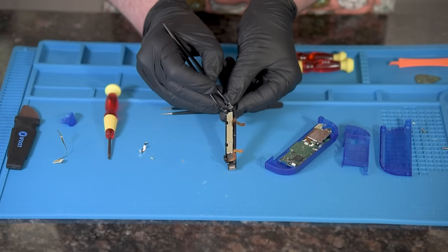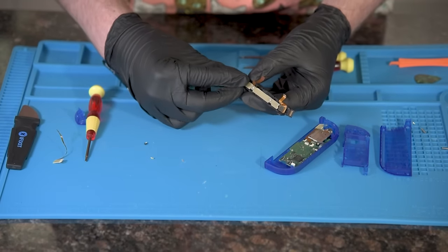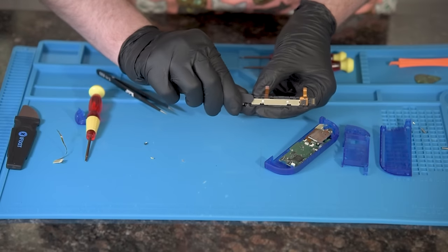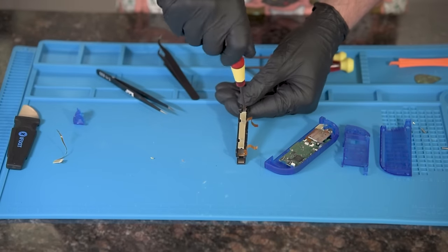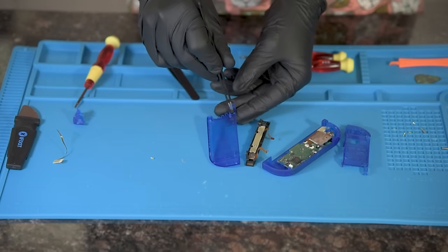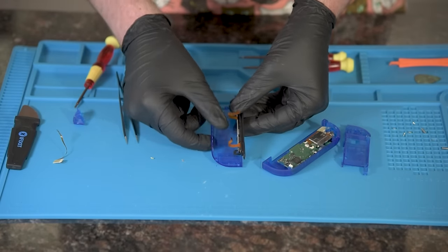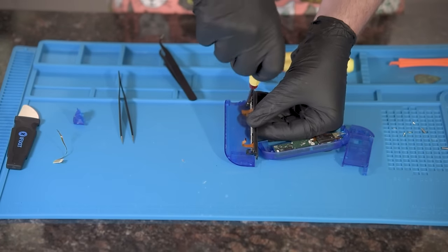Now we put the spring in the latch clip thing and slide it carefully, handle side facing upwards. Put the staple bracket over the latch and use the black screw to keep it in place. When that is finished, we will take the back shell and place the slide button in the hole. Use regular size screws to hold it in place.